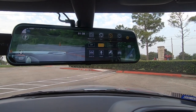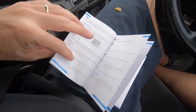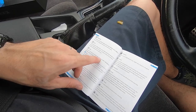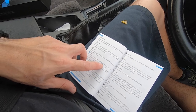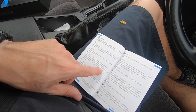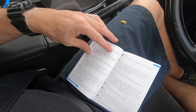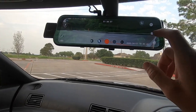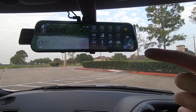Cycle — I had to find out what that means. It changes the record time of each video. Options are off, one minute, three minutes, or five minutes. If you choose a time length, the new files will overwrite the old files. If you choose off, each recording will be saved in three-minute time lengths and the dash cam will stop recording once the micro SD card is full. You definitely want to set cycle to five minutes so it keeps going.